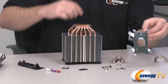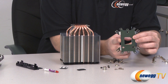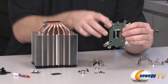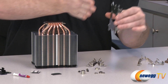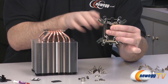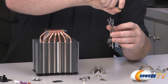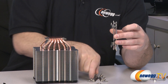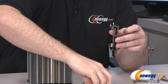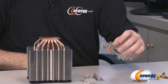I wanted to give a quick overview of the installation procedure. This is a universal mounting bracket — it has insulating tape on it, and you want the tape side facing the motherboard. If you have an AMD motherboard, use the AMD side against the back of the motherboard. If you're using an Intel motherboard, use the Intel side — and don't peel that tape off, it needs to be there. You secure it at the back with the included bolts, so you will need to access the back side of your motherboard, either by removing the motherboard from the case or using a cutout if your case has one.